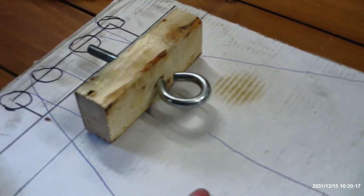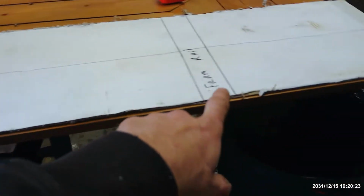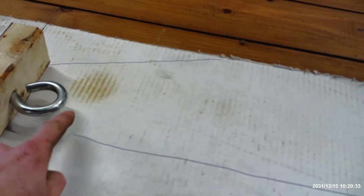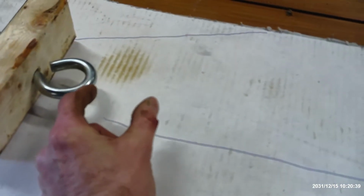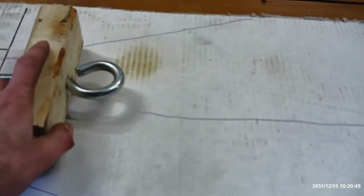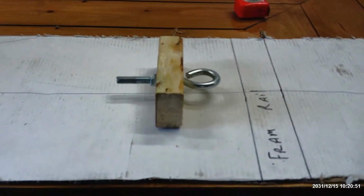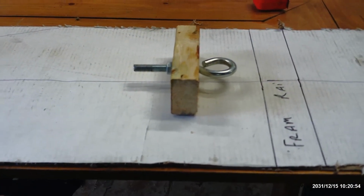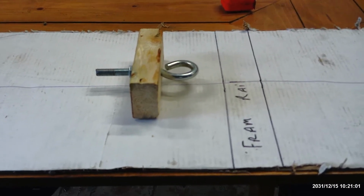I hooked it up and cranked it, and this is to scale. There's 24 inches between these two frame rails. By the time I ran the wire, picture this blue line as your metal wire coming back in, and I looped it through and put a cable clamp on it, the eye bolt added 2 inches, and the cable clamp and loop added 1.5 to 2 inches. So when I cranked it, it hit about right there, and I could only get about 16 inches of pull out of it, which did not even come close to fully extending it. You need the full 20 inches. So I had to scrap that idea